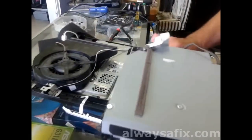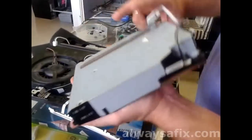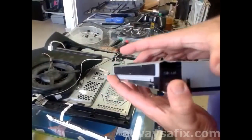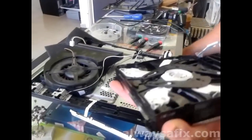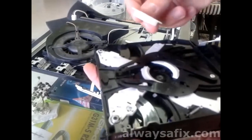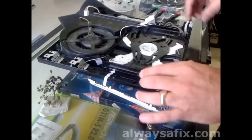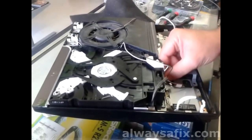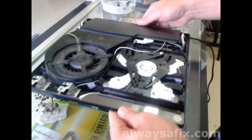So we have the drive. We'll remove these top three screws and these two bottom screws. With the top cover off, this is the magnet that holds the disc in place. Make sure when you're putting it back together that you don't turn this upside down and it doesn't end up out of its correct place — that's very important. Let's just pop this back in and have a look with the cover off. Power it on and see what's happening with the disc.